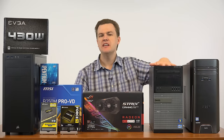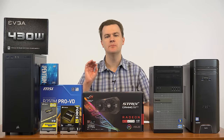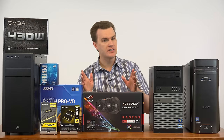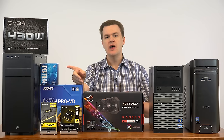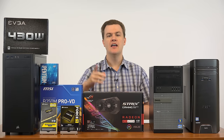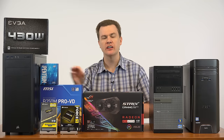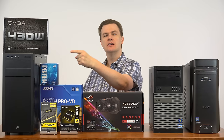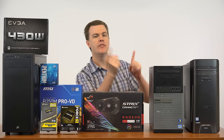It's true this machine is six years old. However, Intel processors are only getting a 5–10% improvement in instructions per clock cycle per generation. That adds up over time — across the six generations between second-gen and seventh-gen, there's probably a 35–40% improvement in IPC. This Pentium is 3.5 GHz and does more per GHz than the older chip, so if you're playing a game that only uses two threads, the G4560 is undeniably faster than the i5-2400.